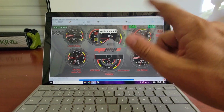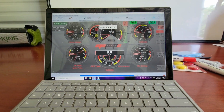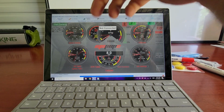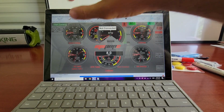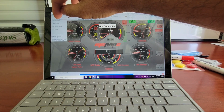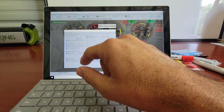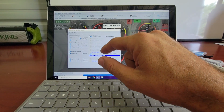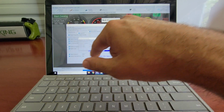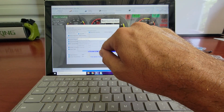Okay, I have the paid version of TunerStudio now because it does the tune analyze live, and that was pretty huge. It was worth 70 bucks and really helped me dial in the volumetric efficiency table. For now, I'm going to go through pretty much each setting and show you what I did. I might have to explain some things as I go, like the required fuel. Basically, it does this sometimes. I'm not going to mess with it.